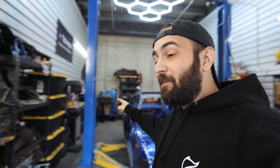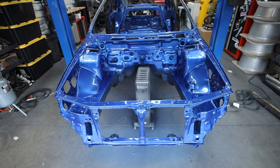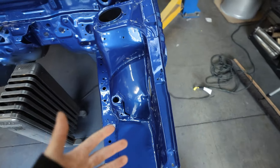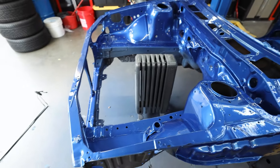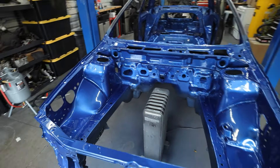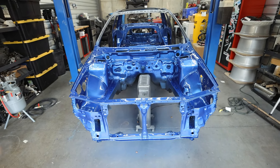It'll help clean up the amount of parts that are absolutely scattered everywhere in here. Now, because this paint is still fresh, I want to avoid doing anything that's going to require screwing bolts, nuts, or anything like that into fresh clear coat, so that way it can still cure and harden up over time. So the majority of the stuff we're going to be doing are things like brake lines, things that go underneath the car, the fuel tank — stuff like that — so we don't ruin our fresh paint job, because it looks so incredibly good.